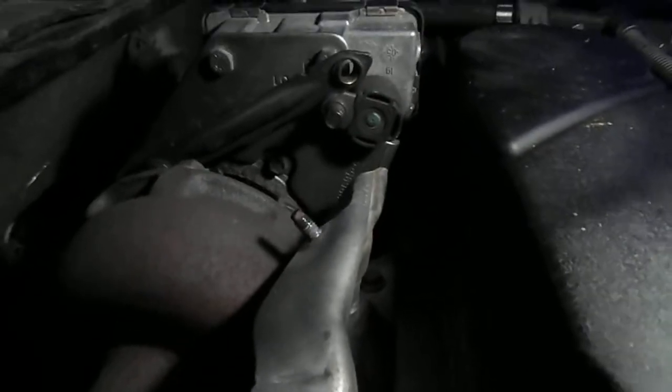So yes, in a way it's that turbo box — in another way it's not the turbo box, it's just a little arm. Give it a go, might work for you, might not. And if you don't want to, you can always just whack it back and put it back on. But anyway, might help someone out — it's worked for a couple. If you're going out buying a box first, it's probably the back of the vanes on the turbo — try and give them a clean out. What it generally is, is the ones on the back that you can't get to. There are a few other videos on how you can clean it. Good luck.